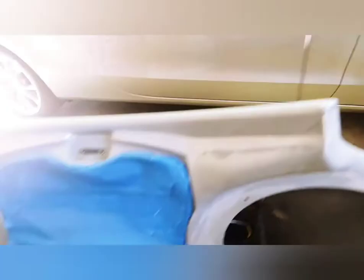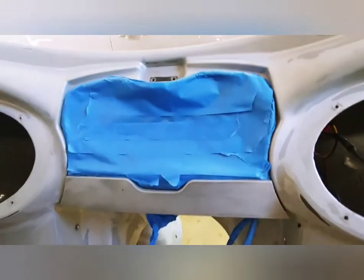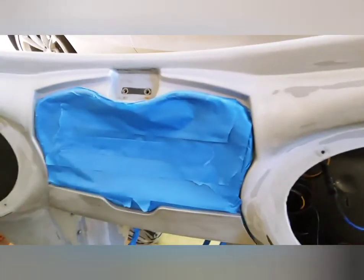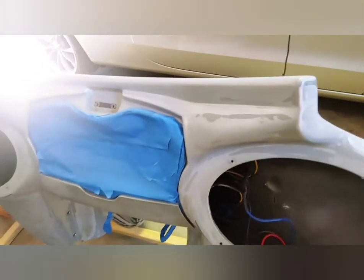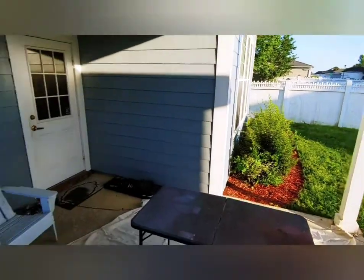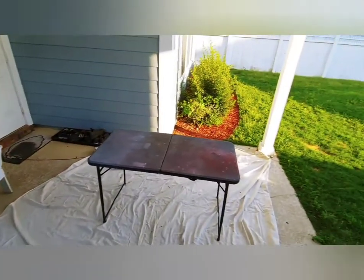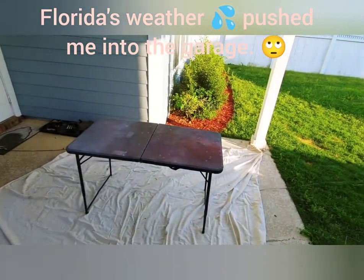Make sure you do a final cleaning of all your products when you finish sanding, then tape off anything you don't want exposed to paint - any wires, coverings, pockets, or seals around your saddlebags. This is my homemade paint booth - it's a breezeway. Anything that has airflow will work. That's my little 20-gallon compressor over there. You want anything that's going to create an airflow to get the overspray off.